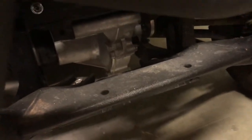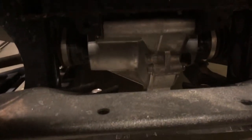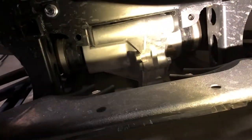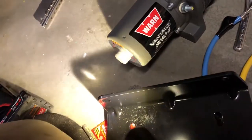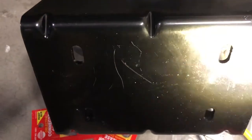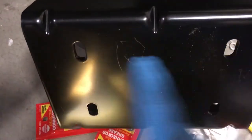The first step is going to be to get the mounting plate bolted in. If you look back here, there are two bolt holes — one there, one there. Those are going to go through the bolt holes on the mount plate. On the bottom of the mount plate, the winch has four bolt holes on the bottom, and these bolt holes are the ones that go with the ones in the frame here. We'll get those first two bolts in, then we'll work on getting the winch in.